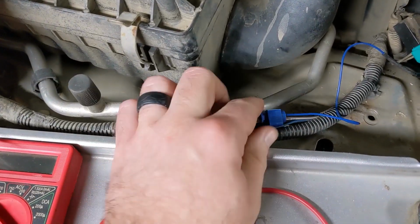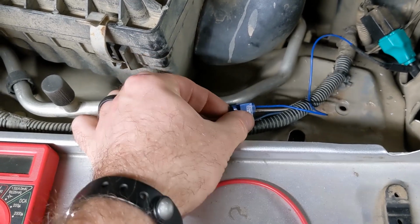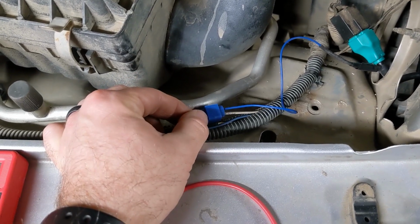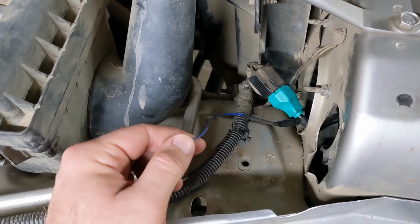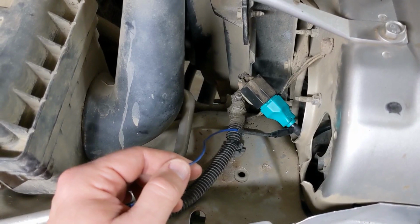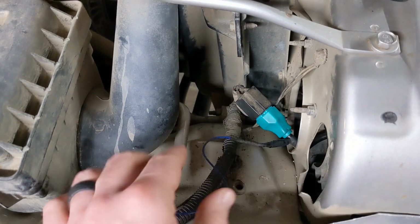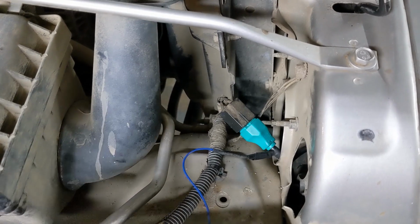I used one of these little connectors. Some people call them Vampire connectors, some people call them patch connectors. There's lots of names people use for these things, but whatever. I patched it in there. This runs to, if memory serves, the green lead, to the connector on the ATC headlight. There's also a red lead, which is for the running light, or the daytime running light.